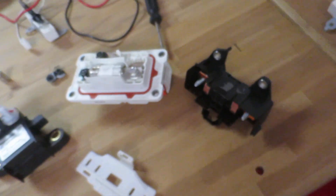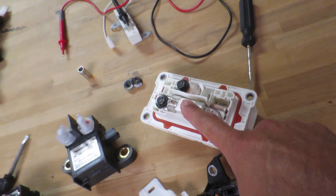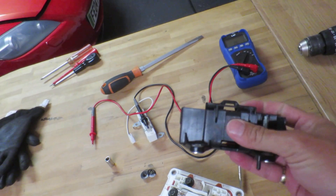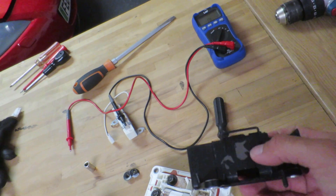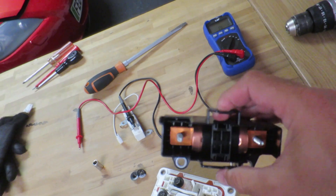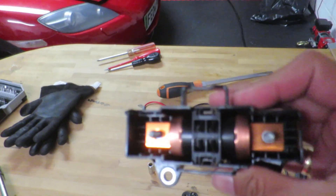What I've also got in my goodie bag is a new fuse - a 300 amp fuse. The original one is 225 amps. I know I can pull more amps than that, but this is out of a 110 kilowatt Leaf and I've got 160 kilowatts in here. I've got new code which tells me how many amps I'm pulling, so I'm going to keep it below 300 amps. It won't pop at 301 amps - you have to push it way over 300 for quite a period before it would pop, so I can use that and get a good level of performance.